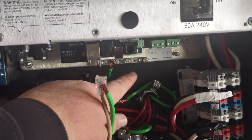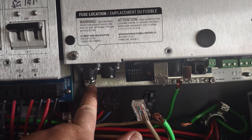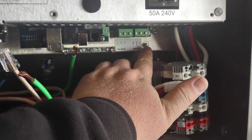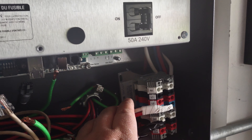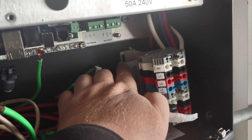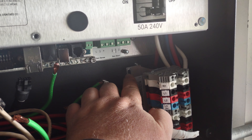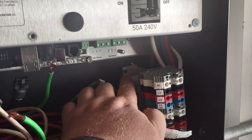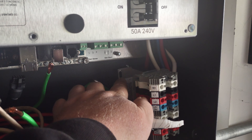If you can see down there, we've disconnected all the grounds. Now there is a bolt here — a little nut that has to come off here and a little nut that has to come off here. Those are 10 millimeter sockets, and then this one right here tends to be like a 7 millimeter. From there you need to get a quarter-inch socket set in there to get that out.